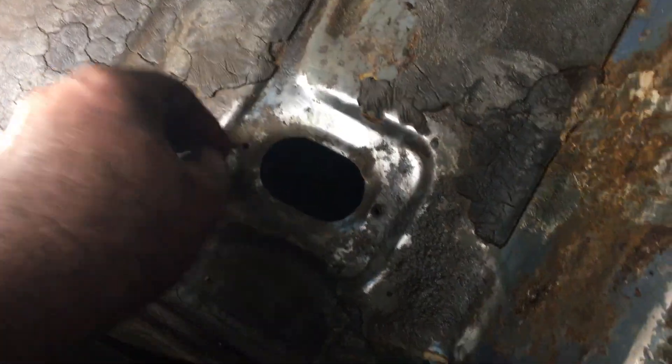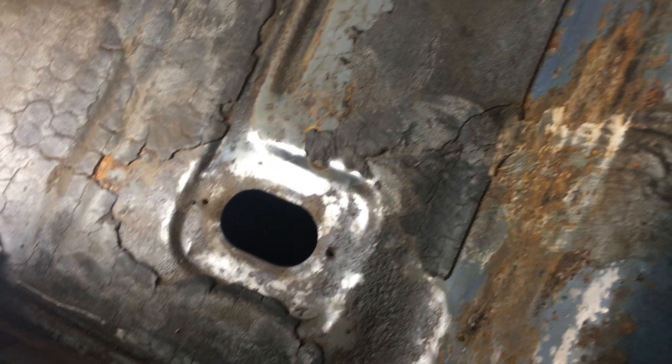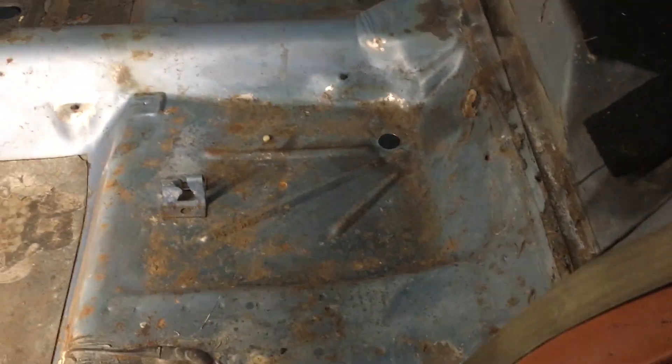No dramas through there — that's just surface rust. I've done this full inspection, I've dug into it. It's all surface, all good. That's just where the seat belt mount is, that's just dirt. It's all just surface stuff from moisture — no water ingress that's obvious anywhere. It's looking good, looking really good.